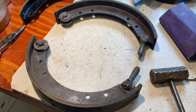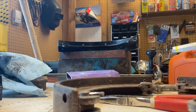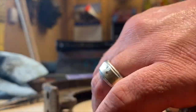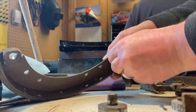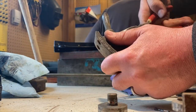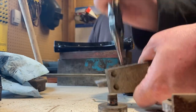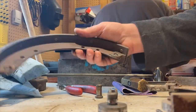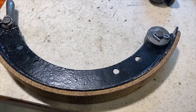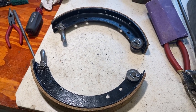Over at the bench, we removed the roller pins, brake shoe rollers, and the brake adjusting shaft from the brake shoes on the left side. We inspected the rollers, pins, and brake adjusting shafts — all of them appeared to be in good shape, just dirty. The adjusting shafts for each shoe should be equal length and bevel, and the rollers should be perfectly round. If not, it's a good idea to replace them, otherwise your brake shoes will not center correctly.